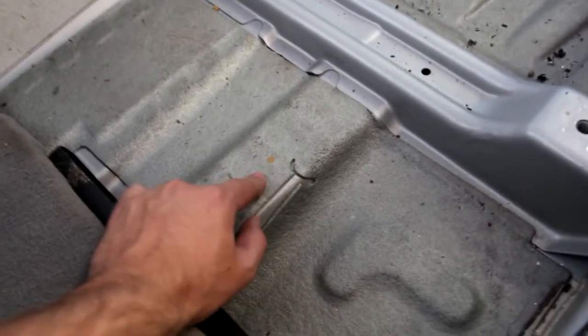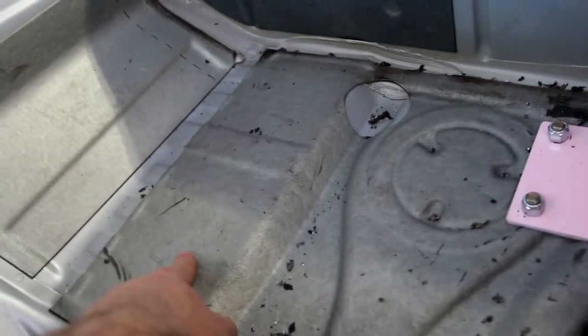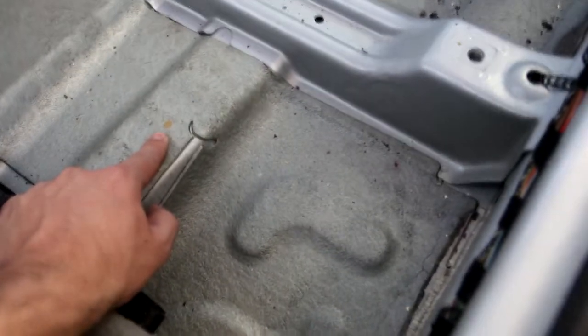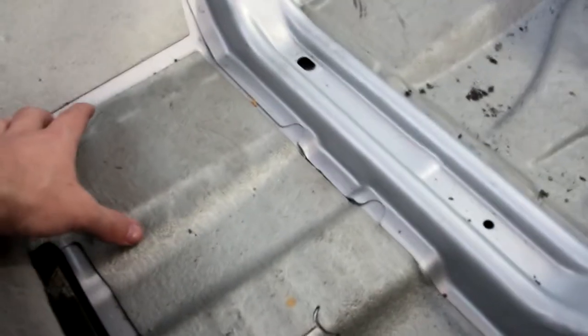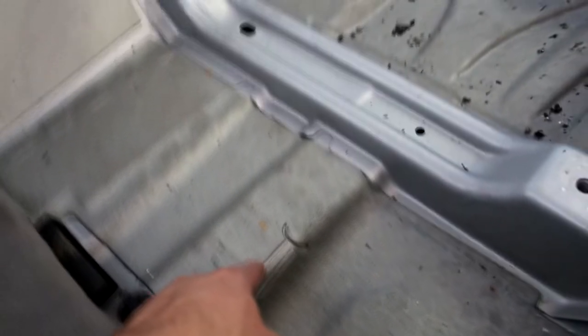For the floor mounting points, one of my anti-submarining belt points is going to go here — I've marked it and set up the seat to get an idea of my angles. The other anti-submarining point goes here, and the waist belt point goes back there. I know those are safe places to drill. However, this whole channel right here has brake lines, so I'm going to drill these two holes and then go underneath to find the safe spot to drill across.